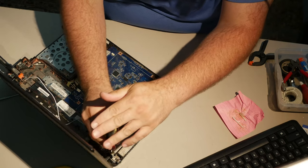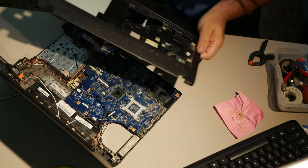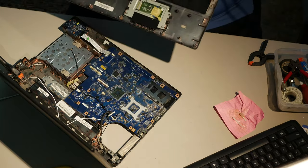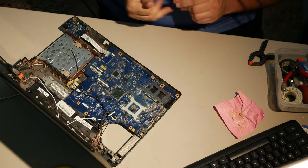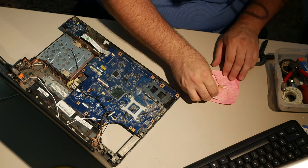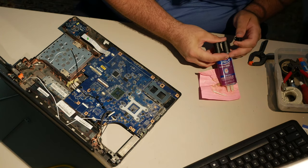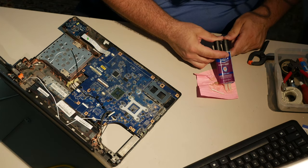over there especially hard. You do have to be careful when you do this kind of stuff because this has speakers. If you look here, it has two speakers. And those speakers go in the holes to the sides of these hinges. So if you put epoxy in the wrong place in too large of a quantity, guess what's going to happen? That's right. Your speakers won't go in. And then that doesn't do you much good, not being able to put the speakers back in.